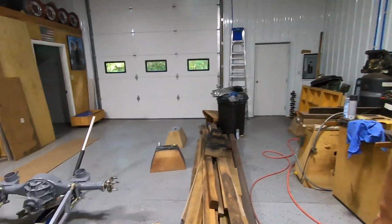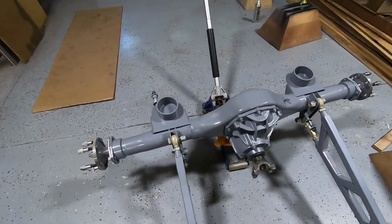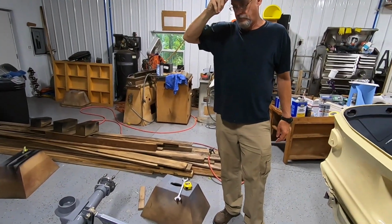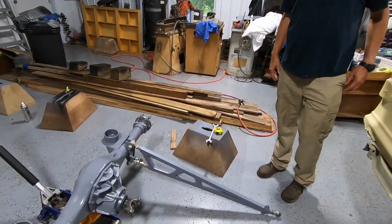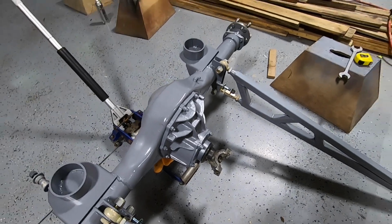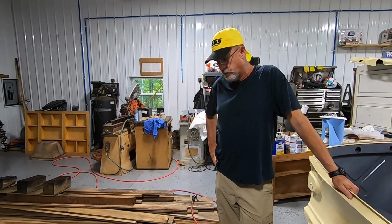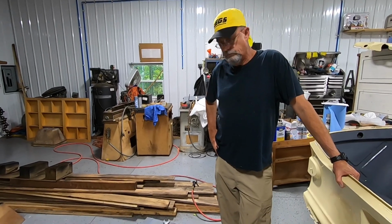Yeah. So this is the rear end. Yep. That's probably the best component of the car. We went pretty good on that. That's all quick performance stuff there. Well, except for the nodular center section. That's a strange engineering. I was going to say, that's a nodular. Yeah, that's a strange engineering picked up, used from some drag racers. Okay, cool. And like I said, it's all pretty good stuff on the inside. I don't think our little 6-cylinder is going to tear that out.